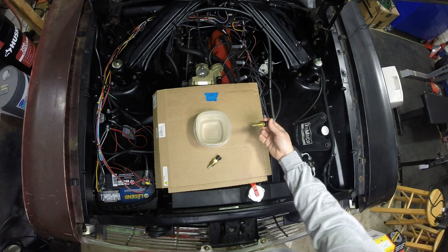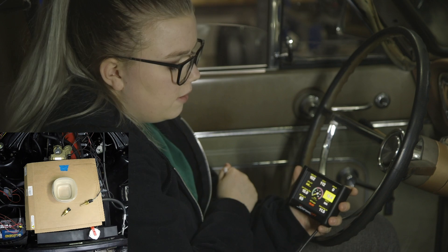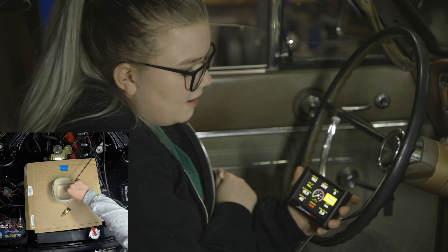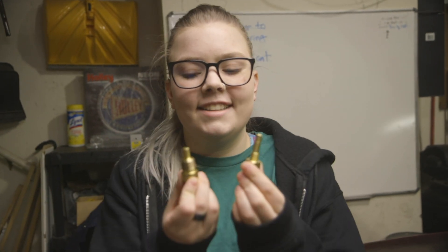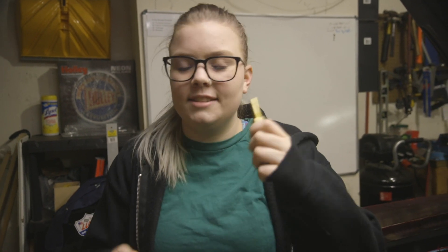The new sensor is on. When turned on it says 112 degrees. We put it in the water and it reads 210 and still going up — so that obviously didn't work. The temperature was way off. Unfortunately we cannot use this sensor, so we're stuck with the original one. At this point we were starting to run out of options and were getting desperate.